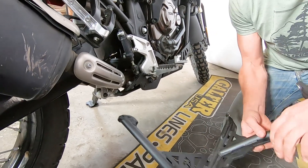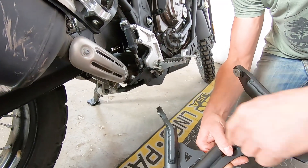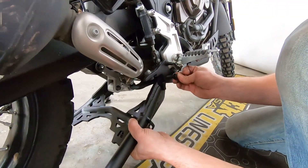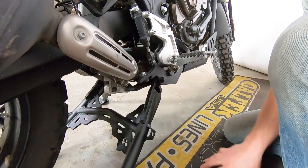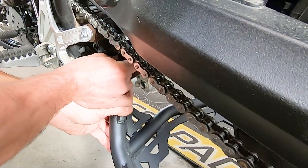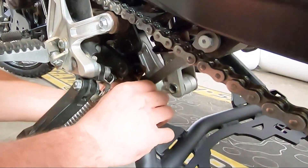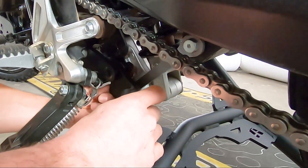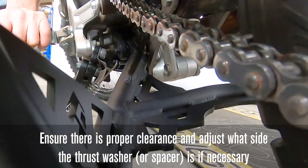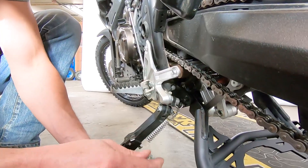I'm on the rider's right-hand side to give you a better view. We've got the M10 bracket spots on our brackets that are hung. Get the center stand in place with the thrust washer, spacer, and grease. Let it rest, then jump over to the other side — feed the bolt in from the center of the bike the same as the other side, get it started in the bushing and into the center stand, then roll the whole assembly up and push it through. Double-check that you've got clearance from the swing arm linkage to the center stand. If there's a clearance issue, changing the spacer would shift the center stand two millimeters.